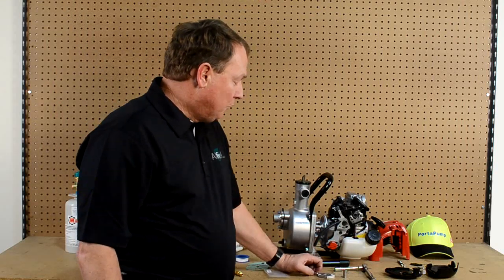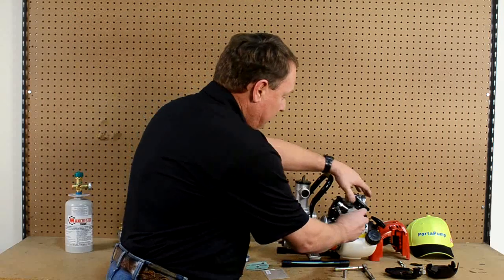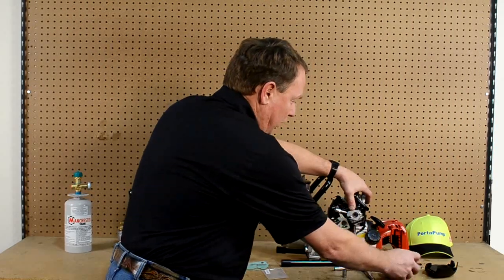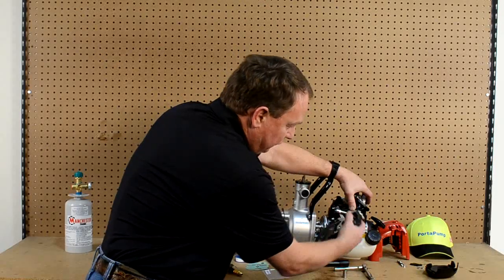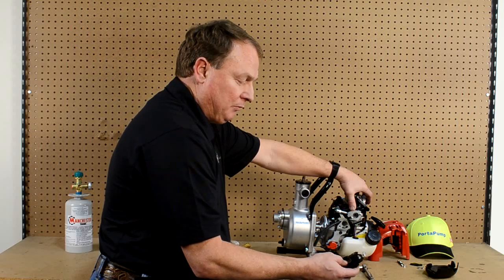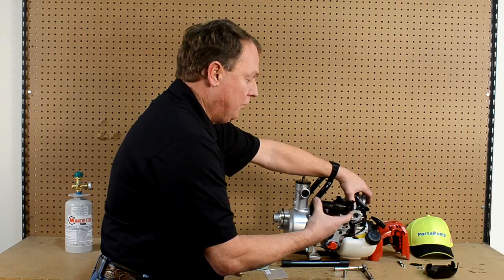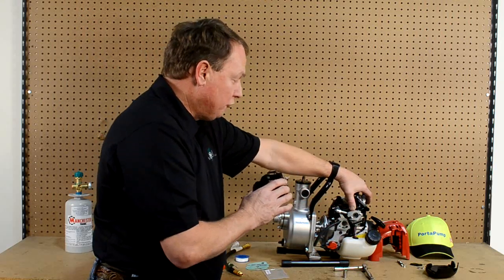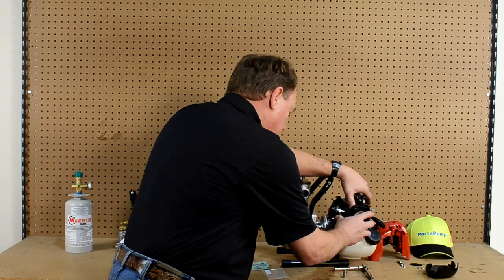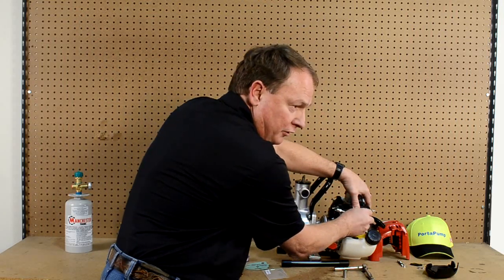I will show you how this Alt Fuel conversion plate is actually installed on the engine, which is extremely easy to do and anyone with a little bit of garage savvy can handle it. You put this plate on the engine here and make sure your o-ring is in there. You will dab a little bit of silicone black sealant at this point so that it seals together — the reason being that when this starts to run it will draw a good vacuum. We will put the plate on and secure it with a couple of supplied nuts that come in the package. They do not need any Loctite.